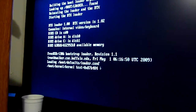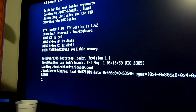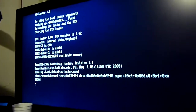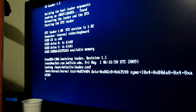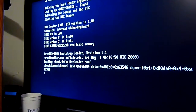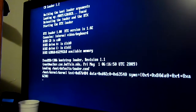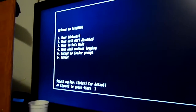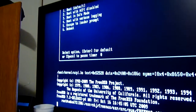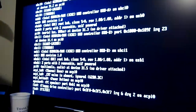There's a lot of long, boring status information about your hardware. FreeNAS is based on FreeBSD, which is the operating system — a wonderful, very Unix-like, Linux-like OS. FreeBSD's kernel tries to figure out what hardware is in your machine and therefore what drivers it needs to load to get your machine fully up and running. You see a short prompt here with only a three-second wait, because the machine is designed to operate headless and doesn't want to wait very long.